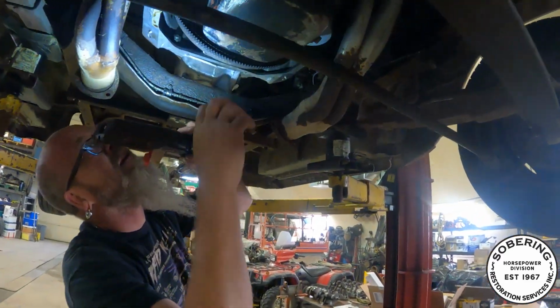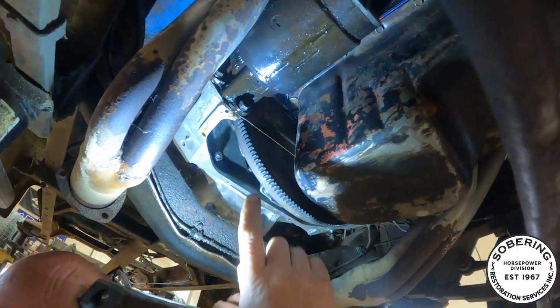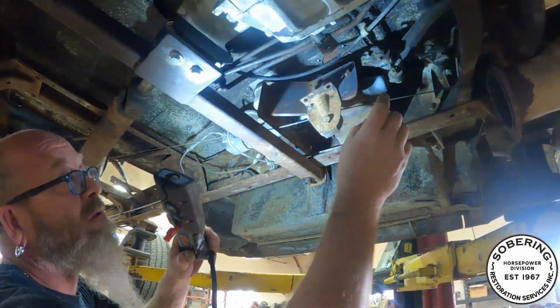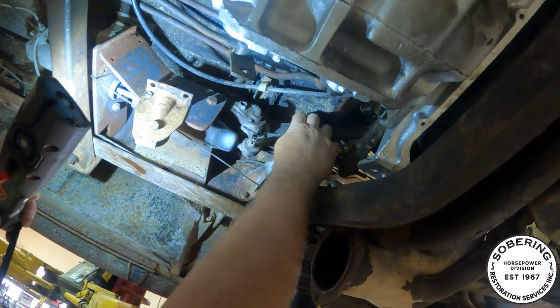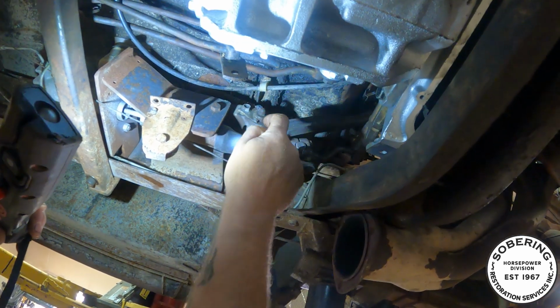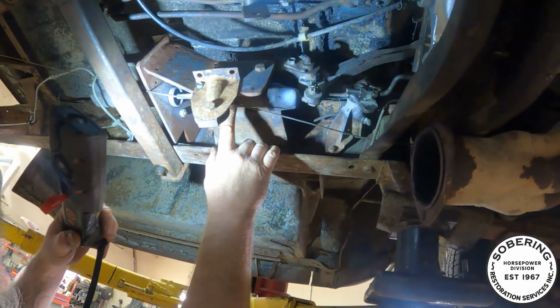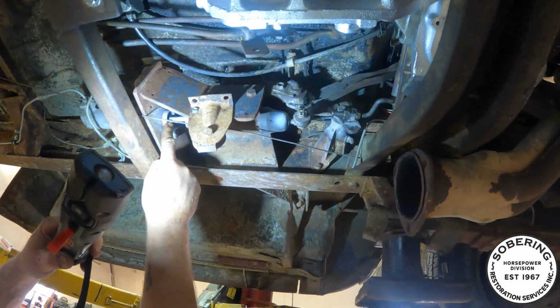Yeah, so obviously I've got an oil leak in here, so that's from the valve cover gasket up there. What I wanted to show you, I was keeping the floor-mounted brake, and in order for the brake pedal to be functional, I had to basically piggyback through the original master cylinder, which I just gutted out, and made a super long extension.